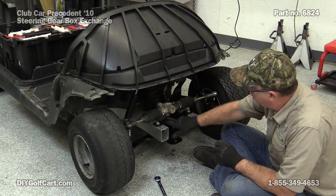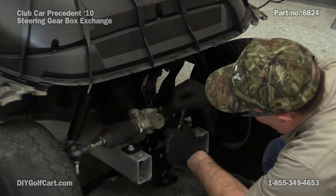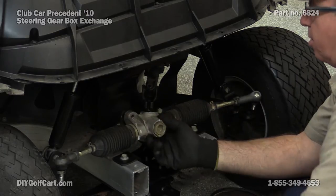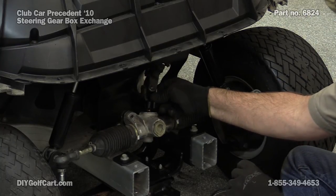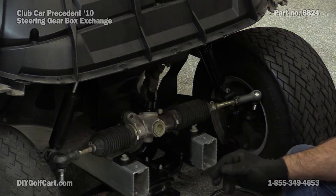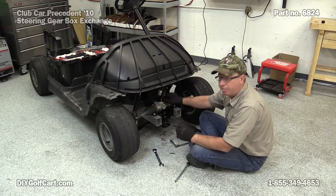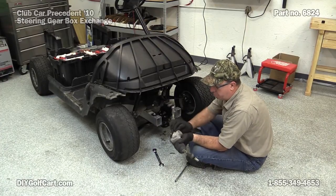Now to remove the mounting bolts. Now I can turn this yoke, making sure that the steering wheel is straight up and down as if I was driving forward. Take a large screwdriver and pry the yoke off the splines, which came off real easily thanks to all the WD-40 that we used. Now let's go get this thing cleaned up and get the car cleaned up and ready to put right back on.